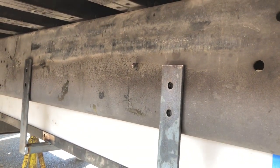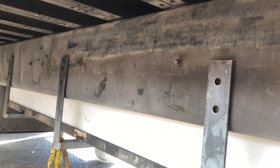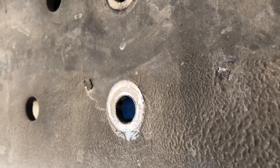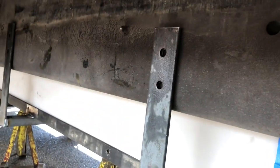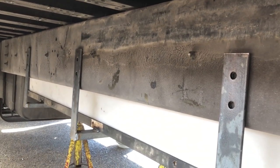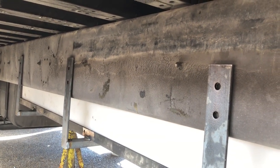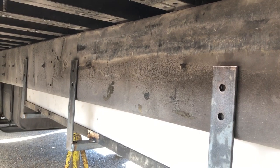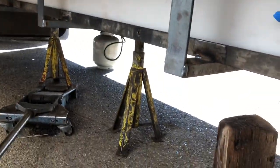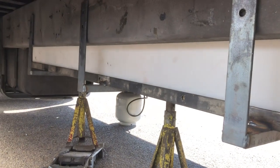I have to raise the tank up and then drill the holes in the mounting bracket. Looking at the thickness of this metal — it's pretty thick. Chris is suggesting I tap the holes instead of having to weld in behind it. I could just jack this up where it goes, drill and tap the holes, and I wouldn't have to get in behind there to weld the nuts. So I'm going to proceed with jacking it up. I got to go cut some extension blocks for the jacks — it's sitting on the jack stands now.